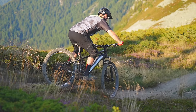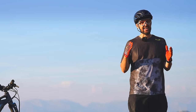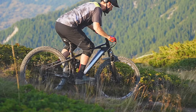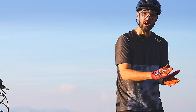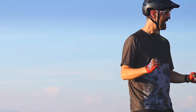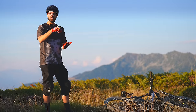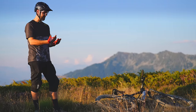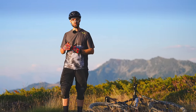That is insane. It slowed down progressively, but got to the point where any more brake would have lost the front wheel. Had I put more weight on the front, it would have applied a little bit more braking pressure. When I reached more grippy hard pack on flatter ground, it progressively applied more braking force and the bike came to a standstill much, much quicker. As the wheel digs into the dirt and weight shifts over the front, there's more grip, so the system can apply more braking force.